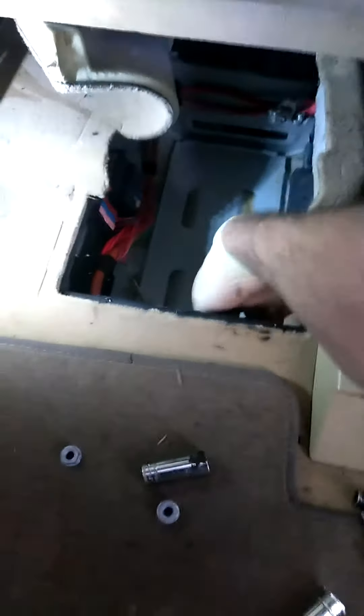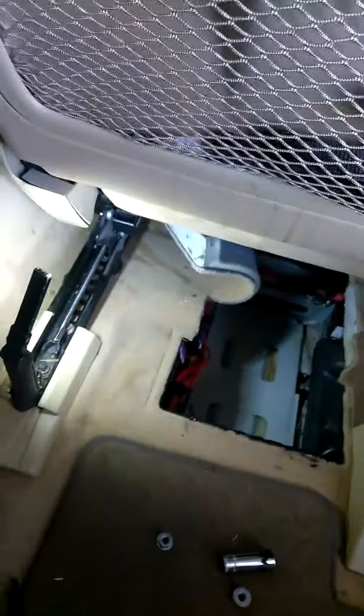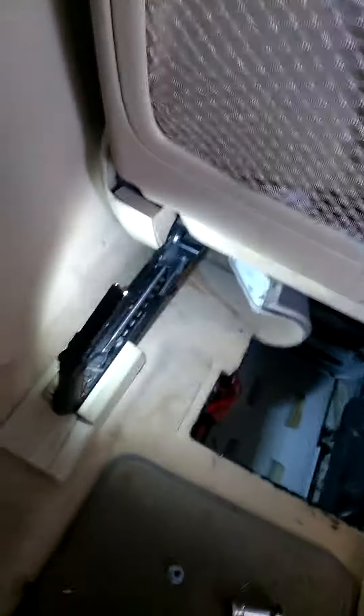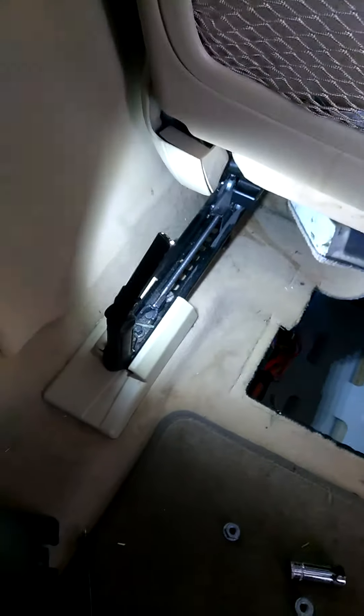Battery cable. There's another battery cable connection here — I just tucked it back to get the battery out. There's a floor vent over top of that, then a miscellaneous vent, and then another cover that retains the battery underneath. So: plastic cover for the vent, pull out the plastic protection tray, pull out the floor vent.